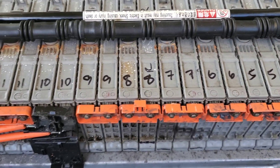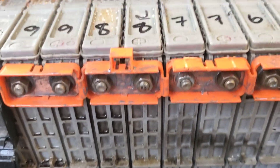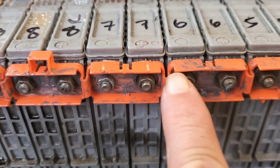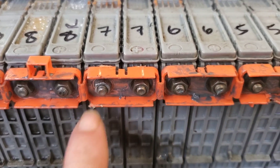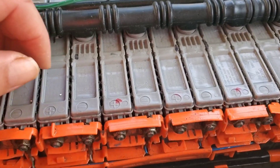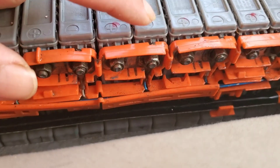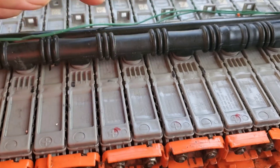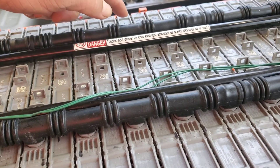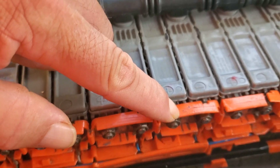There's a total of 14 blocks in the Prius Hybrid. Each block is two cells. You count from the passenger side to the driver's side to find where each block is — this is number seven, for example. I have a separate video on how to replace the individual cell, so you can measure the two cells and find out which one is bad, or just replace both. Remember, this job can hurt you, so if you do it, you do it at your own risk. Thanks for watching!